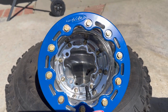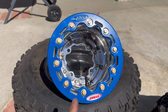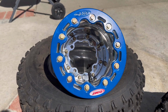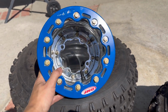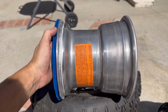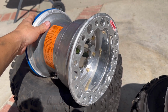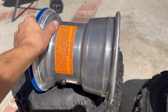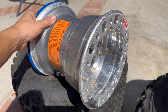And then in the rear, they're just not enough of the 5 lugs out there. So I had to get a centerpiece cut out for a Banshee bolt pattern, and I got Banshee hubs to go on it. Either way, it opens up more possibilities to a lot of rims, but these things are beefy. They're made by OMF in Riverside, California. They're all hand TIG welded, and they also put this little reinforced inner lip that's fully welded, so it doesn't pinch the bead, but it does give the lip of the wheel a lot more reinforcement.